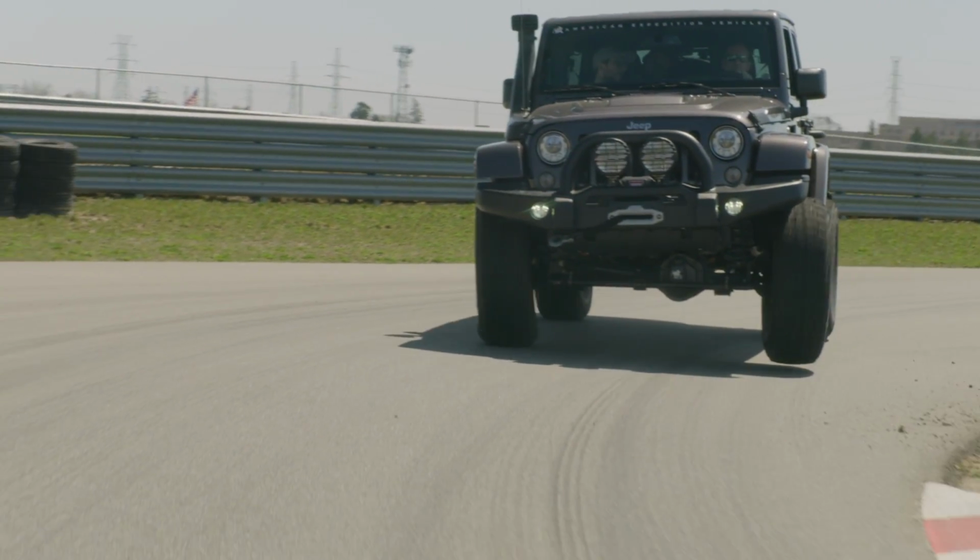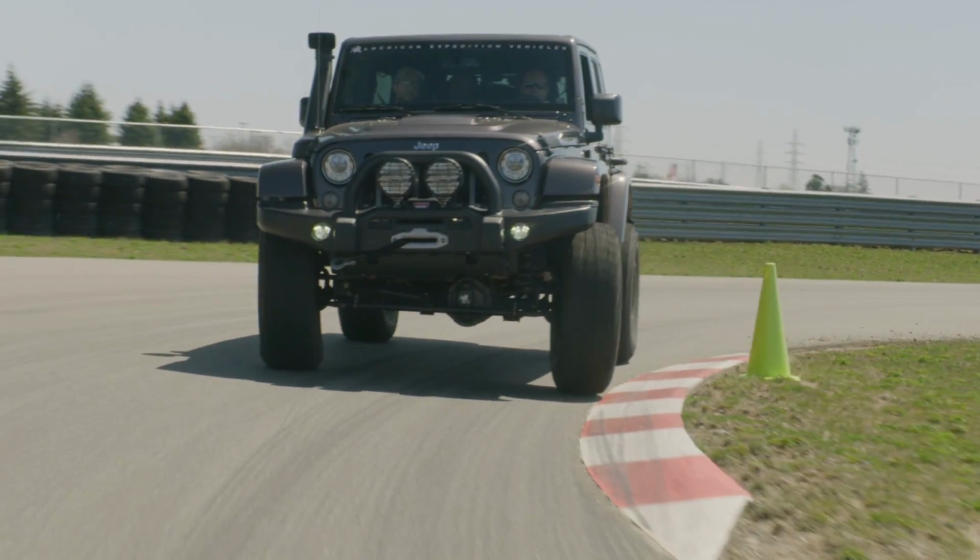We've learned through experience that tire size plays a huge role in testing, not just in the cornering fatigue, but also in the radial test. And that also applies to tire pressure. So when we perform the radial test, we make sure we're using the maximum tire size at the maximum pressure.